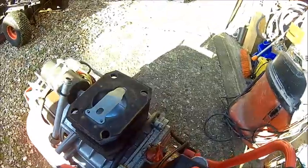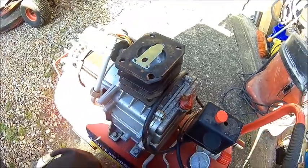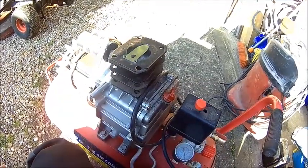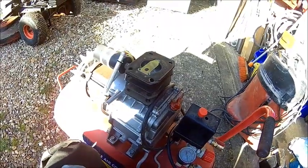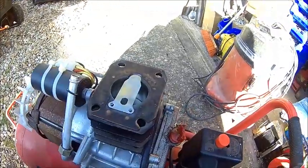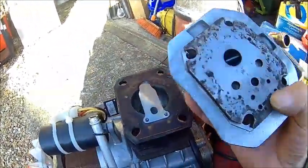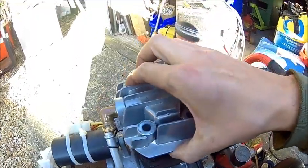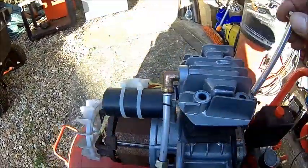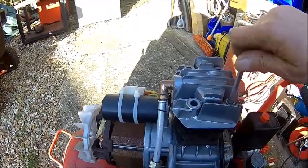We clean the piston as well. Put a little bit of oil in the cylinder and refit it. Give it a try and see what happens. Let me oil the cylinder up and then we'll just put it back as it is. When you put it back together make sure there's no debris — absolutely no debris on the surface. Also make sure you've got the pins here. Put the bolts back in and screw it down.